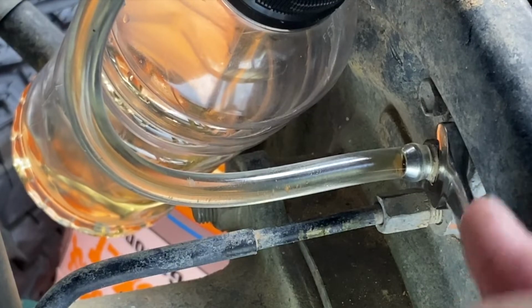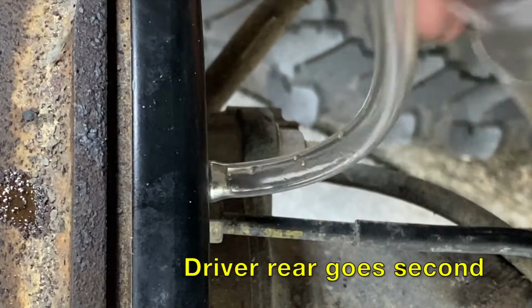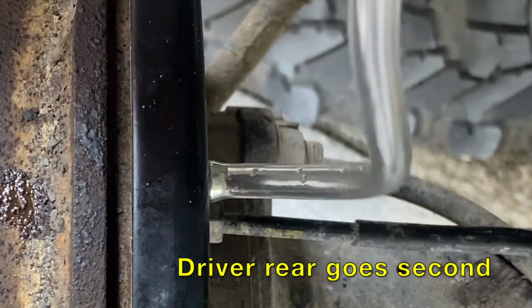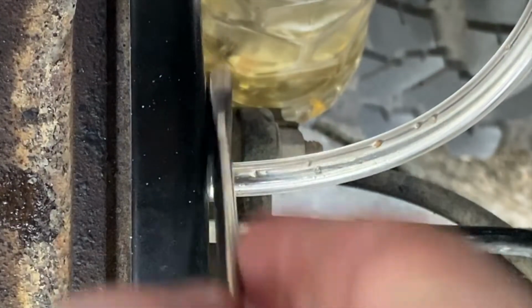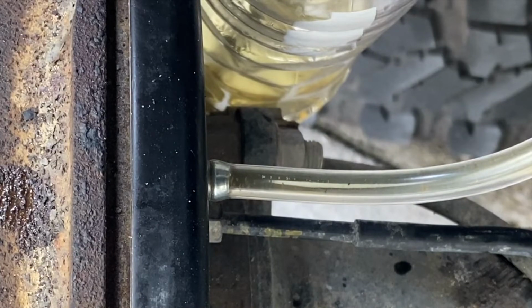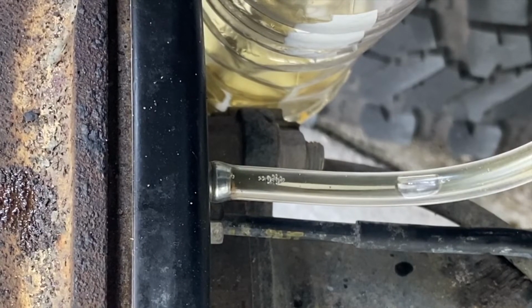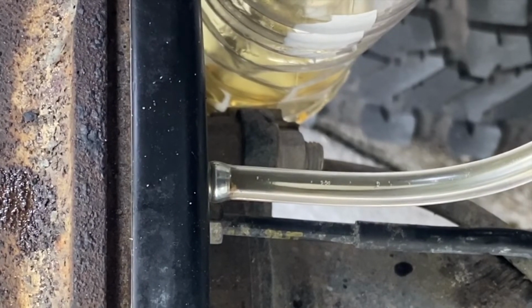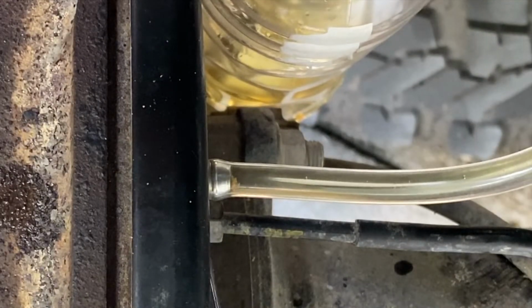We're going to now close this guy up. Nice and easy. Perfect. Pop that in. We're just going to make sure our hose is in the brake fluid. We like that curved up. I'm going to break this loose. Got some air and brake fluid, so I'm just going to give it 2 or 3 pumps. Yeah. A lot of air came out of there. I like that. So let's lock this.